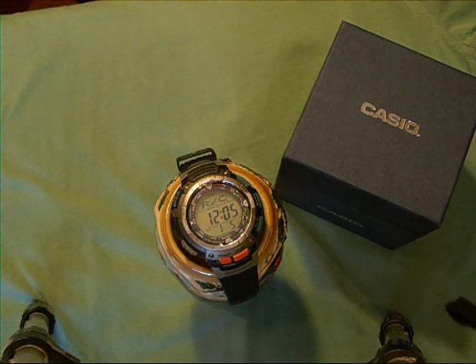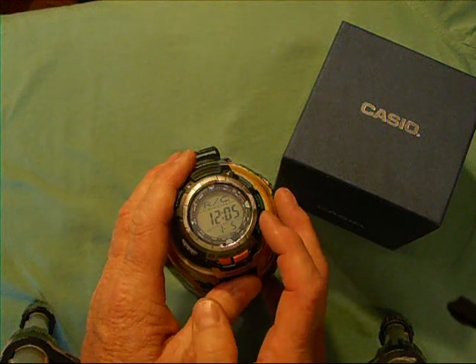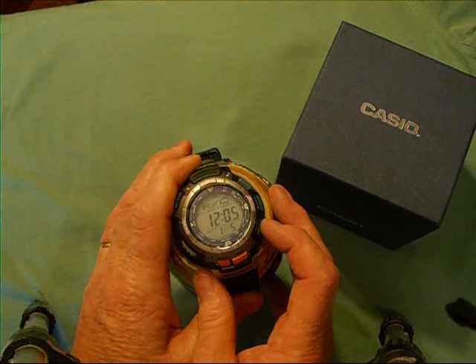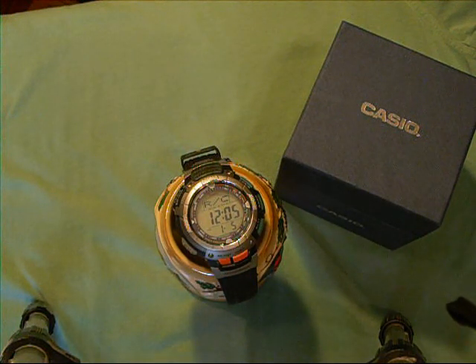When you're first setting up your watch, you might want to do a manual receive from the atomic clock. You do that from the receive screen — hold the C button for about 20 seconds, then release, and it will start flashing AC. When it's done trying to acquire the signal, it will say GET if it was successful, and ERR for error if it wasn't. Typically you want to do that manual atomic clock linking near a window and in the evening. When in auto mode, the watch does its own linking every evening because radio signals bounce off the outer atmosphere and can travel longer distances at night than during the daytime.